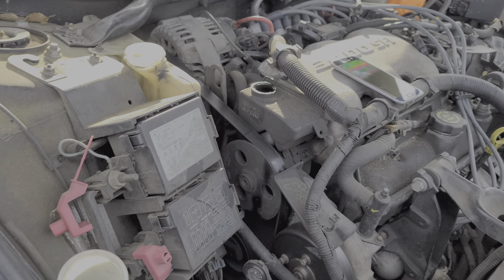When the computer desires faster operation, it will engage these two relays simultaneously — they both come on together. What the fan 2 relay does is it takes the ground of this fan and sends it to direct ground. So in its normal state, when this fan receives power it's grounded through the other fan, which means both fans ultimately receive the power. When this relay engages, the power will go to this fan and this fan only, causing it to spin at a higher speed.